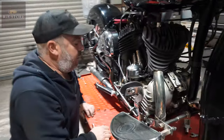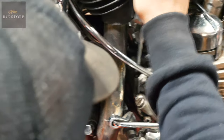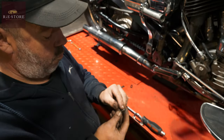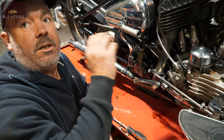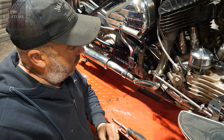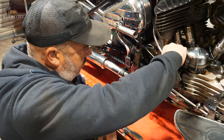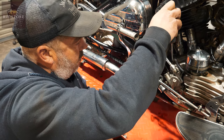Looks like they've taken all the washers out already. That screw there has got a needle on the end of it. From factory that would have very thin washers underneath it, and that allows oil to bypass and mist into that casing to keep the chain lubed up. Obviously with the rubber belt you don't need it. So we'll clean all that up, make sure it's locked down nice and tight, and that should stop any oil going into that side of the casing — which isn't the main leak on this thing anyway.